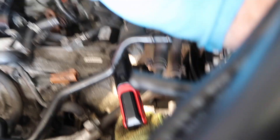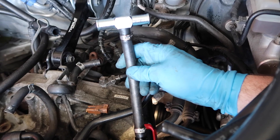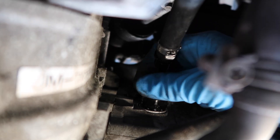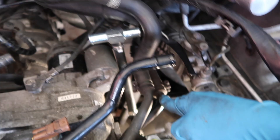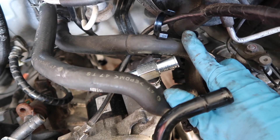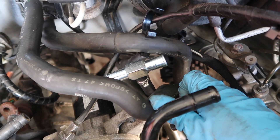What I personally did was I fished this down, connected it up, and then that way you can see where the T will fall. The one running parallel to the firewall is the one we're going after. That connects up to this bottom black hose — that's the hose that we're going to be cutting. It kind of falls right in place with this hose back here, so now we're just going to make a cut right in the middle, shove this on, and put our hose clamps on.